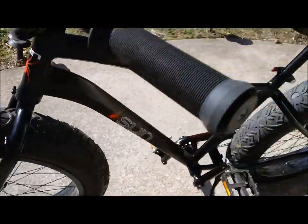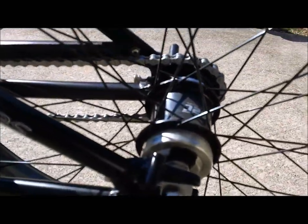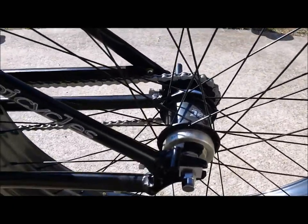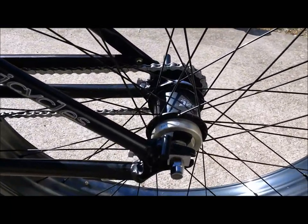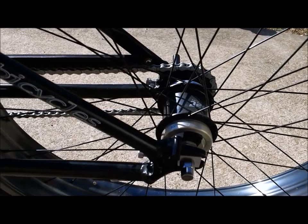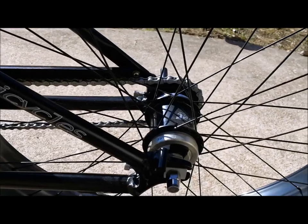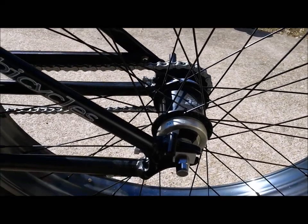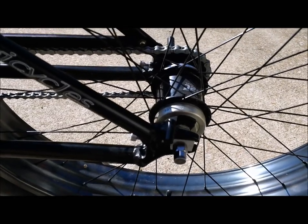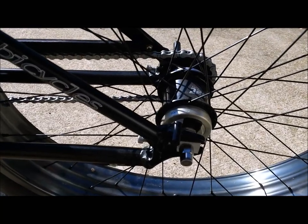As you can see, there is no front brake — all braking is handled by the Sturmey Archer two-speed kickback rear hub with a coaster brake. We all rode coaster brakes as kids, but if you think back, they're basically like an on/off switch: either no power, or you stomp on the pedal backwards and get a skid. Not great control. As is, it's fine for casual use, but for off-road trail riding, throw on a front disc brake before you even head out.